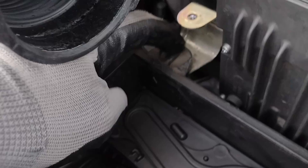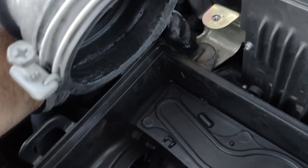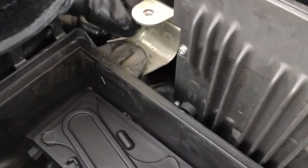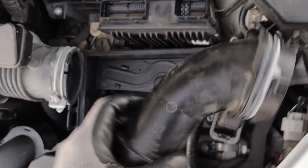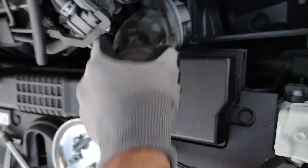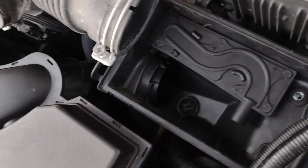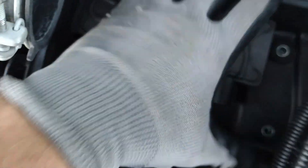Putting the airbox back is fairly easy. Just make sure you put the bolt holes in first, then make sure that little connection to the ECU bracket snaps all the way in so it's flush and firm. Then you can place the plastic elbow, and if everything is connected properly the bolt holes will actually line up — you shouldn't have any problem seeing the holes. Maybe you'll have to wiggle it a little bit, but everything should be aligned.